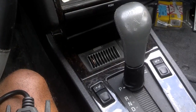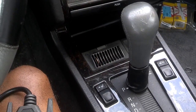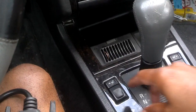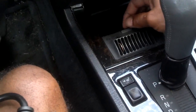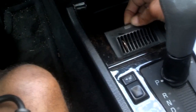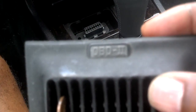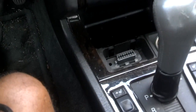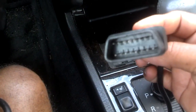This video will show you the location of the OBD2 port and how to scan the car for codes. First thing — in the center console, you see the little coin holder there. You grab that coin holder up in the front, lift it out, and if you look at it on the front of it, it says OBD2. Now you can see the port there.